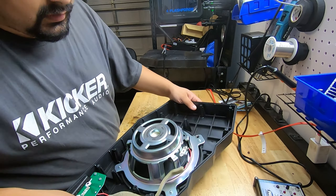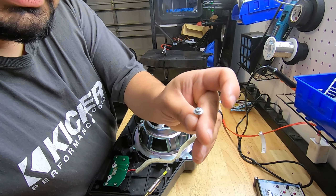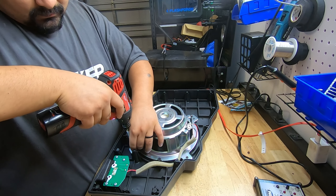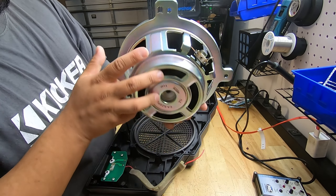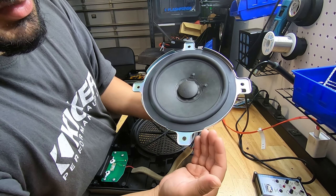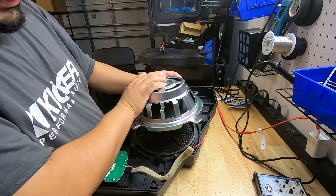Our terminals do look to be soldered on both ends, so we are going to have to cut these or do something with them to get them out. To actually remove this subwoofer it's just four additional Phillips screws. Now with those out of the way I can lift the subwoofer out, and now I'm going to unsolder these. Here's the factory subwoofer fully removed — this looks exactly like the same subwoofer that's inside your regular 2011, '12, '13, '14 Acura TSX mounted on the rear deck. The bolt pattern looks the same; it looks like they just mounted it inside this way instead.